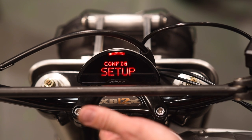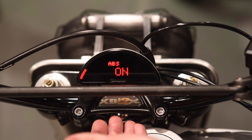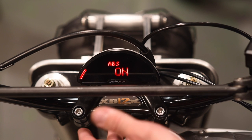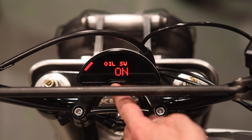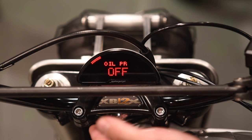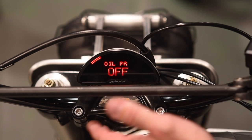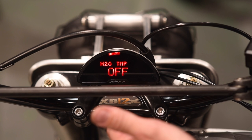Level three button push gets back to the top-level menu. There is another menu — level two to get into it. ABS on: I'd say leave it on; my guess is this controls warnings in general, turning them all off or back on with one push. Oil switch is on — if the oil switch activates with low oil pressure and the engine is running above 1,000 RPM, it will display a low oil pressure warning on the screen. Oil pressure sender is turned off because we don't have that sender installed and we're on breakout box A. Same thing with oil temperature and water temperature — air-cooled bikes don't have water, so those are off.